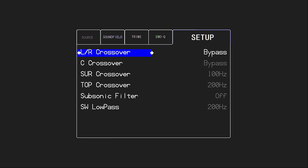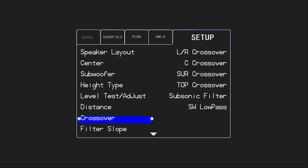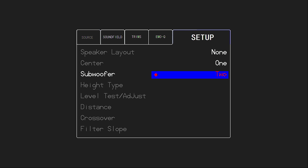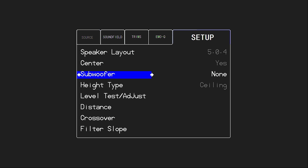If you set your front left and right to bypass — effectively setting them as large — this opens up a couple of other options in the speaker preset menu. When you go to subwoofers, before having the fronts set to bypass you only had options for one or two subwoofers. If you set only the front left and right to bypass, you can then select no subwoofers, giving you options like 5.0.4. If you're not running a sub, all of that low bass has to go somewhere — by designating the front speakers as large, they act as the catch-all for low bass from the other channels. You have to set the fronts to bypass to turn the subwoofer off completely.